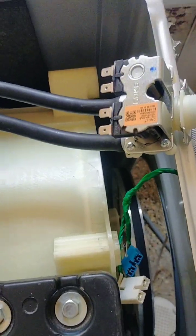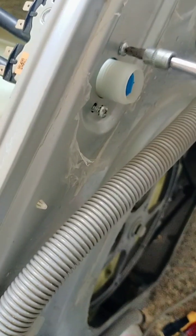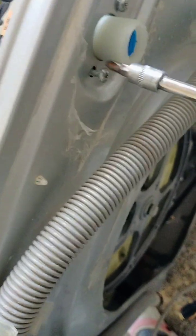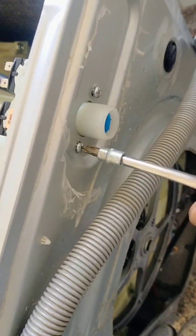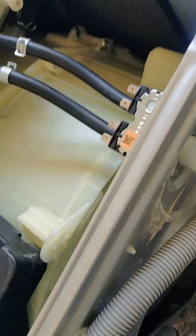The only solution was to replace the solenoid valves. There is a small sieve — a blue one — some machines have two, some have one. It prevents sediments from dirty water or borehole water getting through the valve. What happened here was sediments opened the valve, so there was no control of water flow.